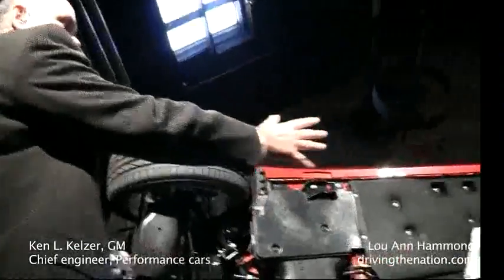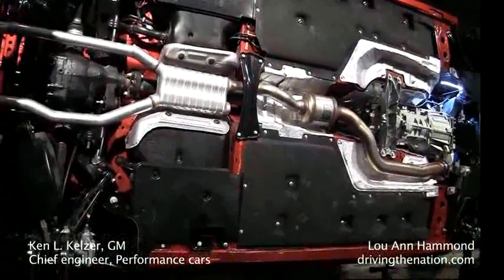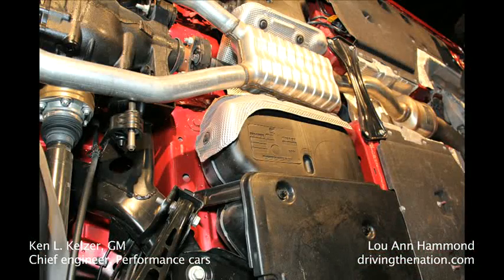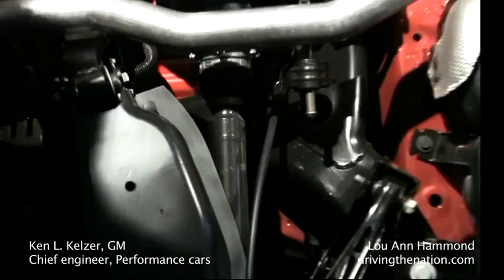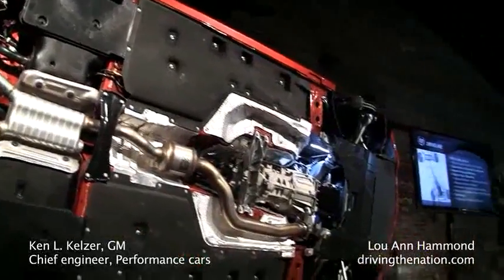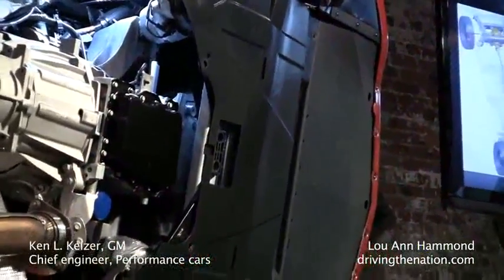See the underbody shielding that we have. This shielding was done for aero — it was done for drag, as well as from an acoustic standpoint. So we paid attention to even around suspension hardware, to make sure that we had the correct airflow. You can see how this thing has a look to it also, from a diffuser standpoint, to get the right aero. If you notice, there's no air dam in the front, so we were able to balance the airflow underneath the vehicle without that.